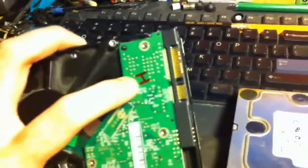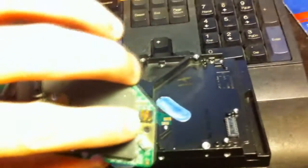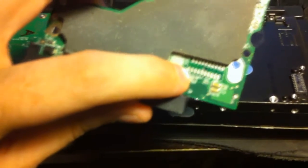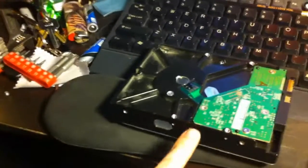It was four Torx screws on the old drive — marked H because it was at my parents' house — and this one's marked A because it was here at the apartment. I noticed there's a 20-pin connection, which is the logical connection between the board and the inside of the drive, and a four-pin connection which powers the spindle motor for the platters. That 20-pin connection was all tarnished, even burnt-looking, on the drive I'm trying to recover.